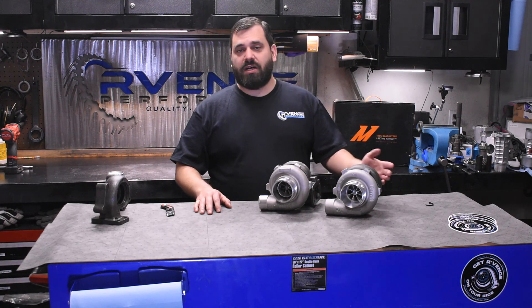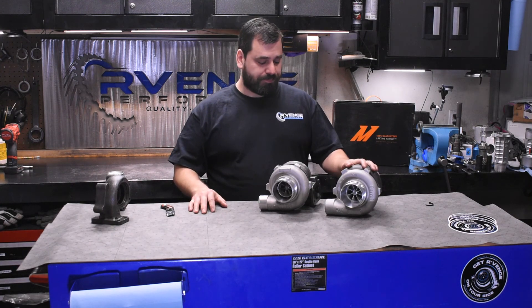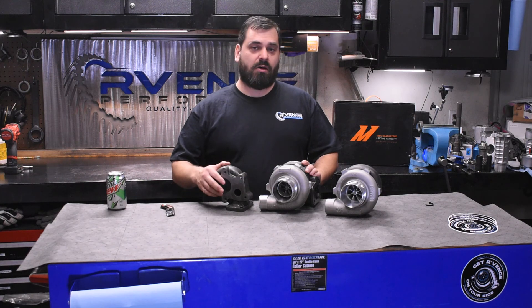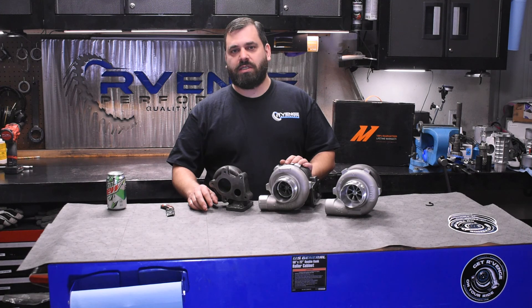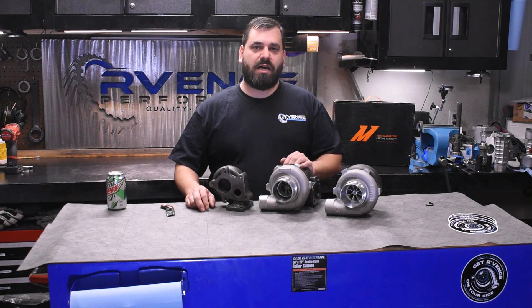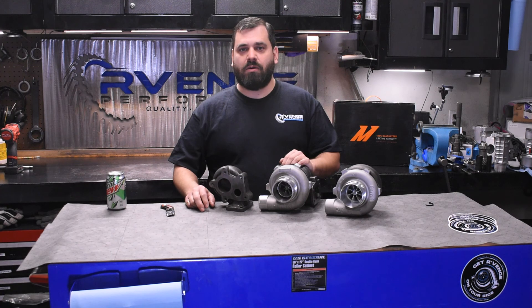That's another nice thing about running Garrett or other standard-platform turbochargers — there's a lot of mix and match you can try. If we get out there and find these aren't spooling at all, we can go up to a 0.86 T3 housing. I don't expect that, but that's something you can do. The same thing with the 2867s — we found the 0.48s spooled exceptionally, probably too good on a stroker, where we would have gone to the 0.63. Just a lot of great options and configurability. If you have any questions about Garrett turbochargers, feel free to reach out. We'll tell you what we have, give you the data we have, or talk with our Garrett technical line to figure out what we don't know.